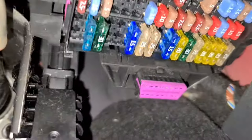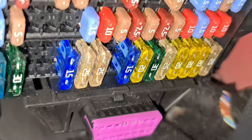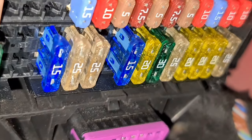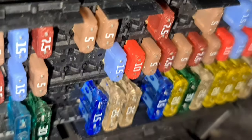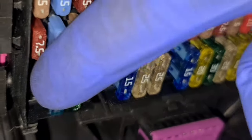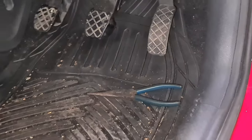On this particular model it is the F36. If I go back in there, you have got numbers written on there — as you can see right there, it's got 22, 23, and then you've got the numbers right there as well. So all you've got to do is go by the numbers. The F36 is what you need to replace — it's the blue one right there.